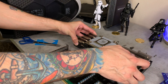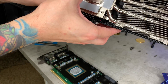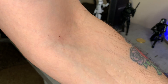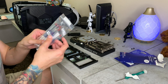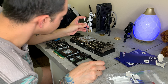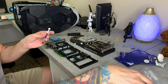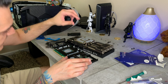I'm going to put another little dab of thermal paste right there in that dry splotch in the middle, and then we're going to reconnect these two wires and bolt up the bottom, and replace the thermal pads on the top plate. I'll have not only the thermal pads and the toolkit linked below, but also the thermal paste syringes. You really don't need too much at all — that's probably more than I needed. They are reusable; just put the cap back on. Perfect — flip her back on her side.